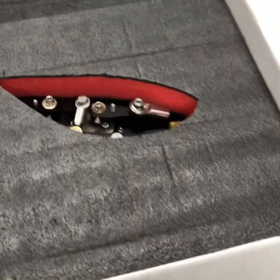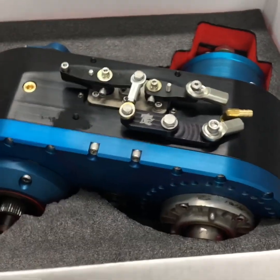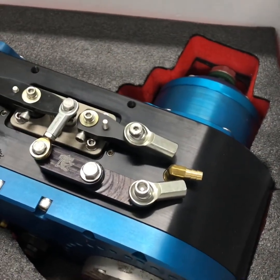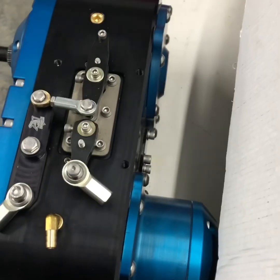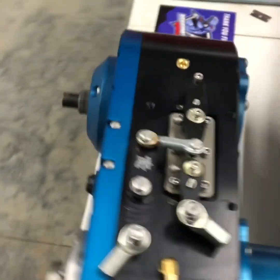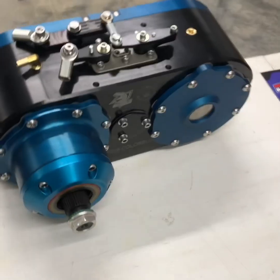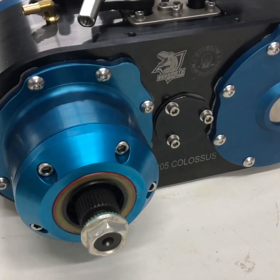Really cool multi-layers of foam with cutouts to make sure the transfer case is protected — not just packing peanuts, but foam cut out the right way so the transfer case does not move or roll around. Got it down to the bottom and just lifted this bad boy out. I've lifted Atlases, full stock 205s, 241s, Dana 300s — and this is definitely pretty light. Looked it up: fully done and geared it's just over 70 pounds. Full billet case milled out of a solid block of 6061.